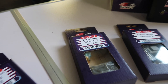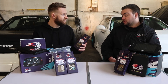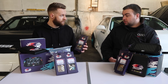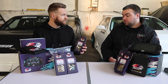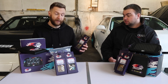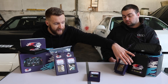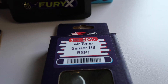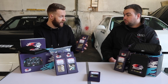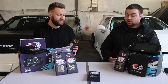Starting off with the first one — water temperature sensor. It basically screws into the manifold just to tell you what the coolant temperature is in the circuit. And is this a direct replacement for the standard one? Yes, for our Nissans anyway — for the SR20 and the RB25, that's a direct replacement for the two-wire sensor already in the manifold, so it goes straight in, which makes fitting really convenient. You're not trying to use adapters or anything like that. Next one: air temperature sensor.